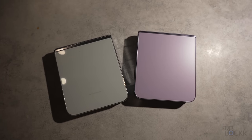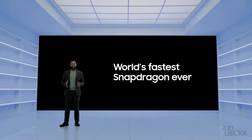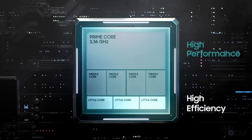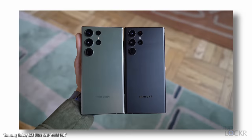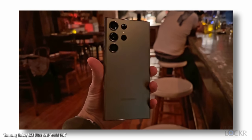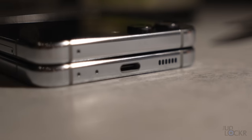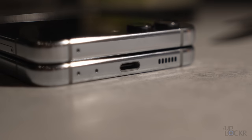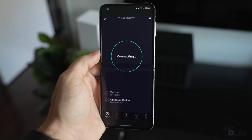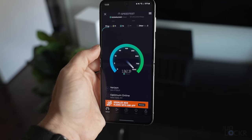So what else is different about the Flip 5 versus the Flip 4? We have an upgraded chipset — the Qualcomm Snapdragon 8 Gen 2 instead of the Gen 1. But the bigger thing for me is that this is now the Snapdragon for Galaxy chipset, which basically means it's overclocked but optimized by Qualcomm and Samsung. In the S23 series where it debuted, it felt better than expected and battery life was better too. Some other small changes: the USB-C port is now USB 3.2 versus the 2.0 they've been using for a long time, so for the rare times you need to plug in the phone to pull off a lot of stuff, it's a lot faster to do so.